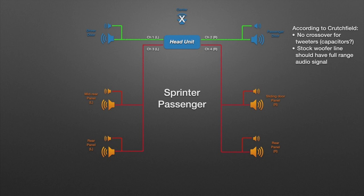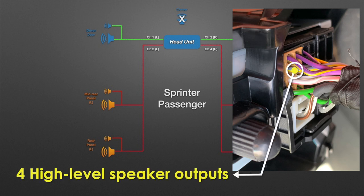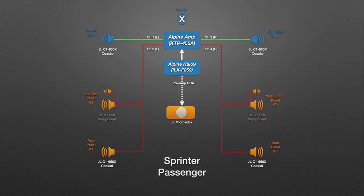If you're only on the OEM head unit and don't have an RCA out, then you have to tap into the left channel and the right channel speaker wire as a high-output wire. For that, you have to wire the left side and the right side of the car and bring them together into the subwoofer, which is probably not going to be easy. If I were to do it, I'd probably tap right behind the head unit where the channel wires come out and bring the wire all the way to the back — that way you only have to tap one single location.